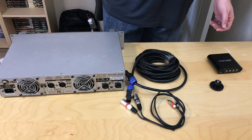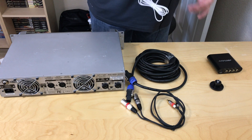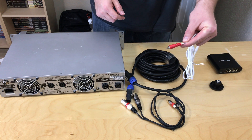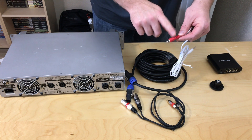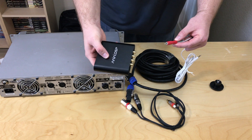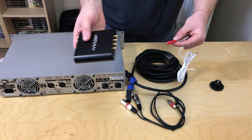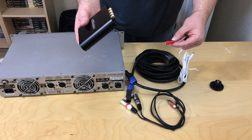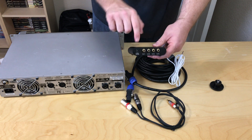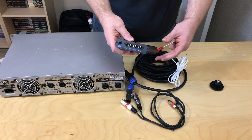First, let's talk about how to appropriately cable the signal path from your AVR to your amplifier. Let's assume this is an LFE output from your AVR — you've got everything set up on that side and this has your bass information. You want to run this into your miniDSP, and this is where you're going to do all of your digital signal processing — this is your EQ. If you look, there are two inputs and four outputs on the back of this box. There's also power here, so pretend the brick is plugged in.